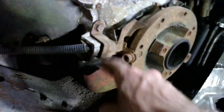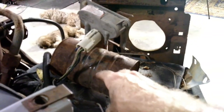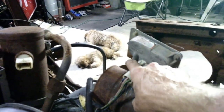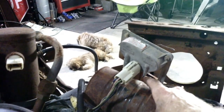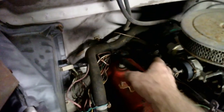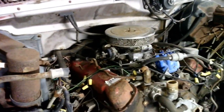But look at this - I thought this was neat. Down here, this guy is a crankshaft position sensor. I didn't know that was a thing in 1982 - that might explain a bunch of the extra wires. Over here, on top of this vacuum bladder, this is a MAP sensor - manifold absolute pressure. You can tell this one says vent to vent, and over here this one says manifold. So there used to be a vacuum line that ran from here to the motor, and it had all sorts of terrible electronic systems trying to save fuel economy - really just giving you horrible fuel economy for the emissions and all that. Back here we have all the original EGR stuff. So we're going to have a whole bunch of vacuum things to remove and never put back.